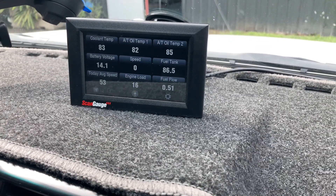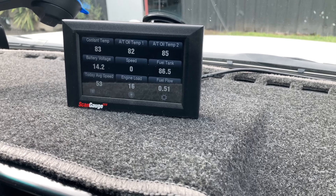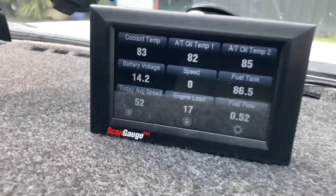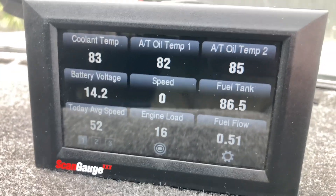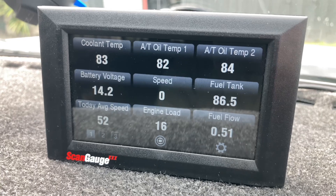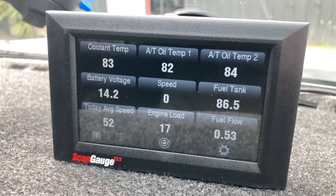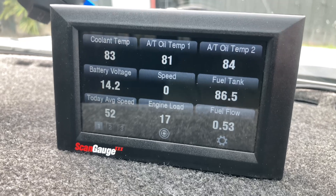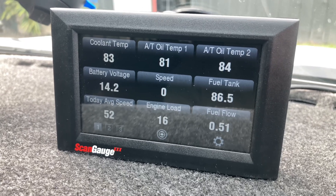Once it exceeds 83 degrees for a few minutes, bring it back to base, let it idle, and it should sit around 83 degrees — draw a circle around 83. That's step one. Does it do that? If it doesn't, is it within a degree? Is it 82, 81? That's okay. Is it 84? It's probably okay, depending on what the results of step two are.